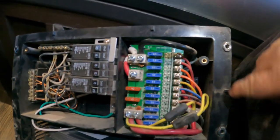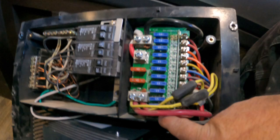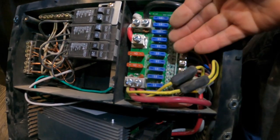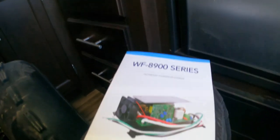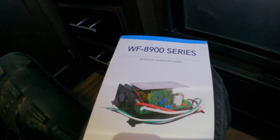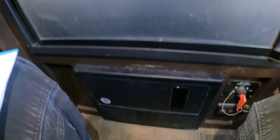While going to install the new one, I had to route the cables behind the board like they were. There's a tang right under here and this whole board will pop out a little and you can get behind it. Okay, that's installed — that was basically a direct drop-in for my model. Let's hook the batteries back up and see if it charges.